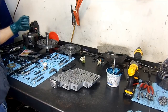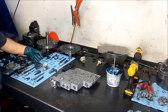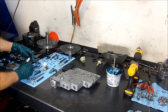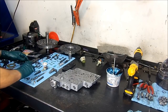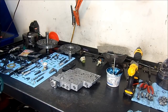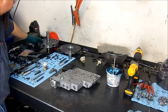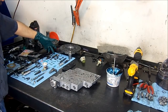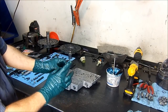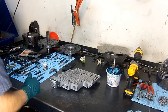We have the TCC isolator valve here. We have the 3-4 upshift overdrive valve train here. The 3-2 downshift — this spring likes to break, always check it. This is our accumulator valve and plunger; this likes to get stuck. There's our spring, and our two shift solenoid valve trains. This is the TCC valve that goes inside the pump. This is the pressure regulator valve that also goes inside the pump. A pump filter. A boost valve — always check that it's nice and free and go back with it nice and clean.